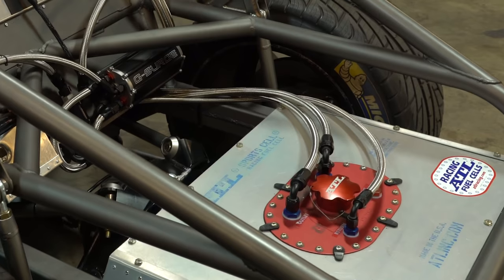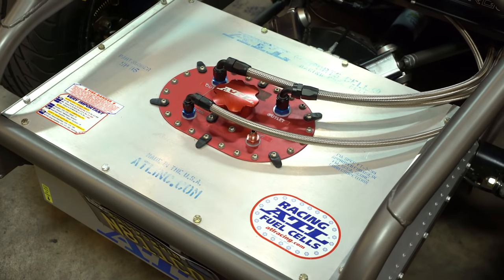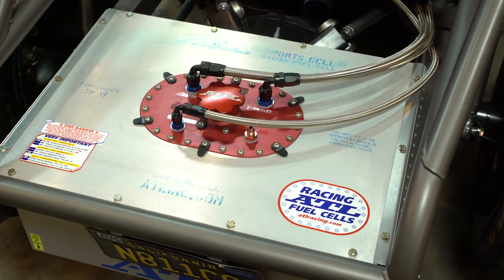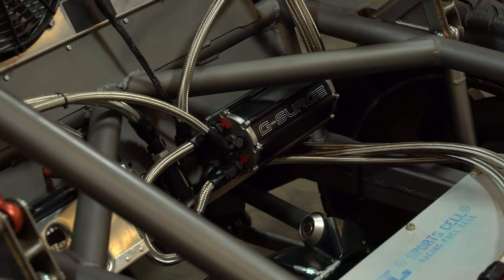For the fuel setup, it's four fuel pumps. The truck's running on E85 — it's certainly overfueled, but I wanted room to grow and not have to come back and refine it. It's got two lift pumps and two inline high-pressure pumps and a 1.5-liter surge tank. Tucked behind the radiator are also coolers for the transmission and for the engine oil.